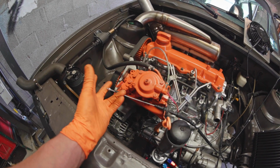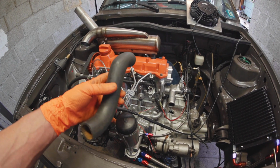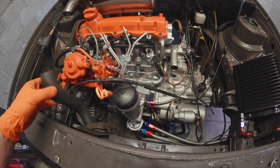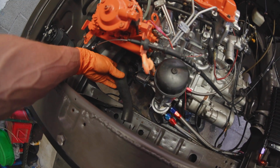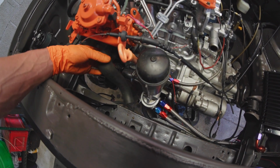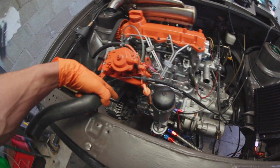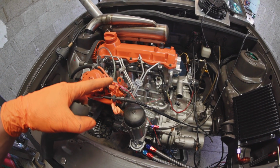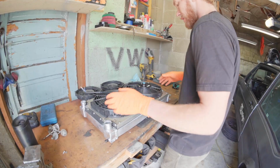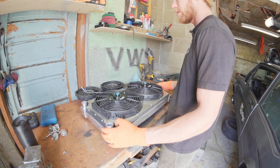So what we got going on so far, I figured out that you can take the 1.6 liter upper coolant pipe, which normally does something like this, and you can trim the ends off it a bit, and it just so happens to work out well to be the ALH return pipe because the outlet of the radiator is down here and the inlet of the motor is about there, and that works. But now I have absolutely nothing to get me from about here to there, so that's really just going to require some measuring and going to AutoZone and hoping they have a tube that fits, I think. First things first though, I got to make this radiator fit, because if it doesn't fit and the fans don't go on it, everything else is silly.